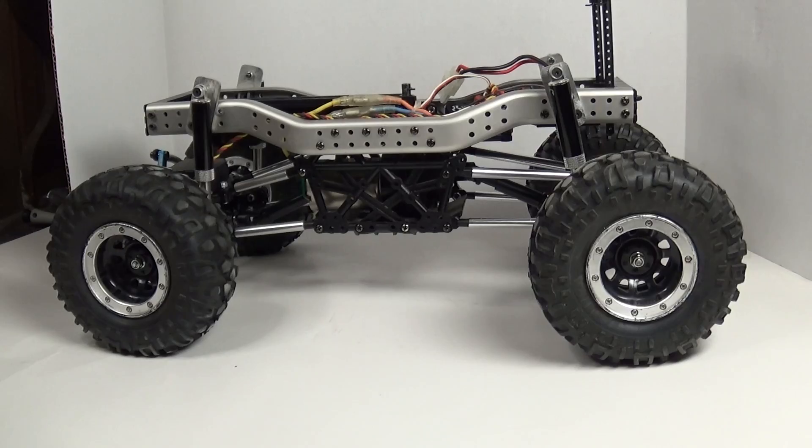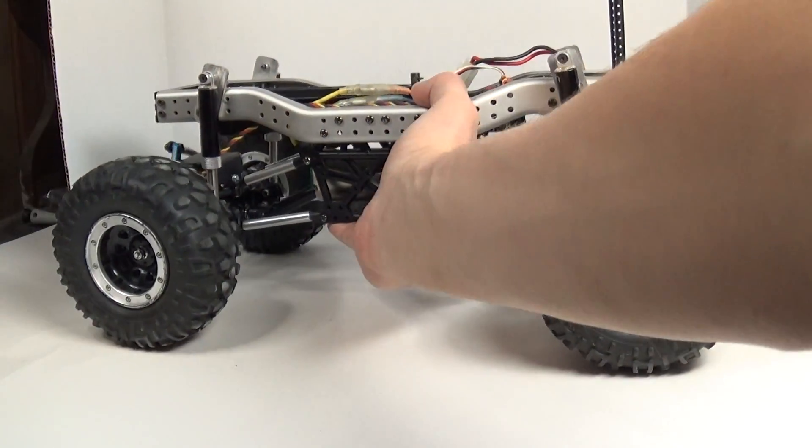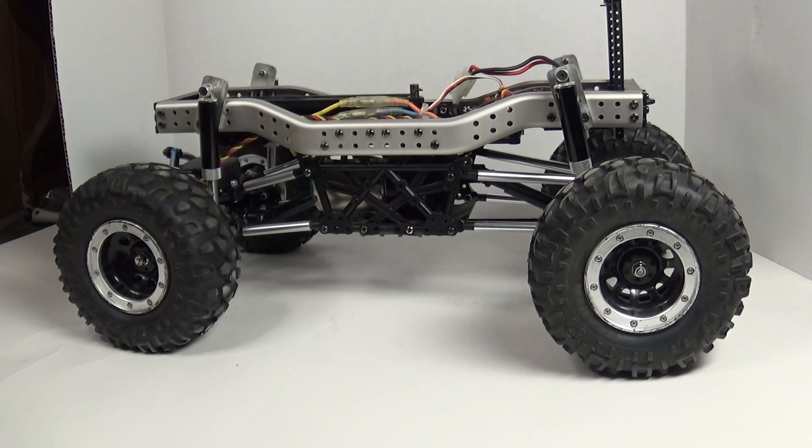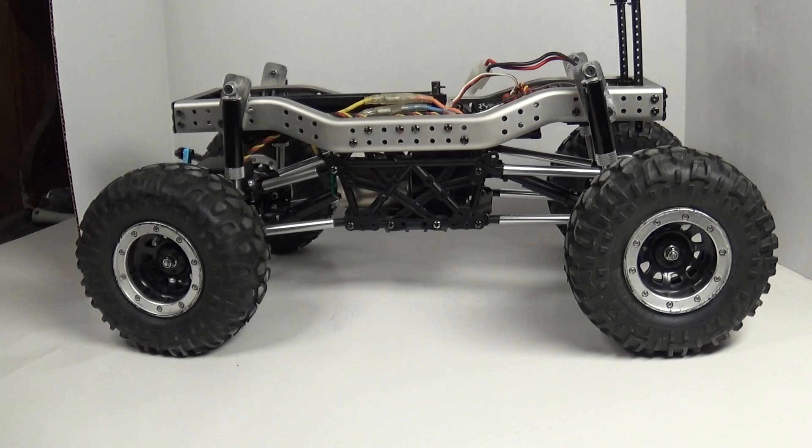I started with these aluminum shock brackets I made to lower the ride height. It didn't come with that cantilever setup that's stock, but I probably would have taken that off anyway just for simplicity's sake. That lowered it nicely. I've always preferred a lower center of gravity rig over something with a ton of ground clearance, because wheel speed can usually get you out of most situations that a huge ground clearance rig is just going to flip constantly.